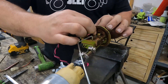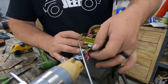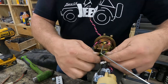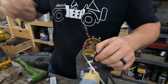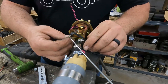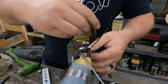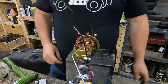We pass the wires through the hole we drilled — I just twisted them to make them a little less unruly. We've got plenty of wire up here to put a connector on to plug the fuel pump in. I'll put one zip tie around this just so the wires are held in place and don't float around. Now the wires are held in place, and we'll use a little Form-A-Gasket up here and let that harden up before we mess with it.